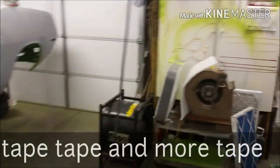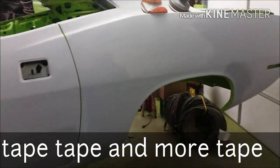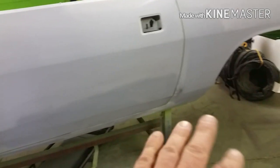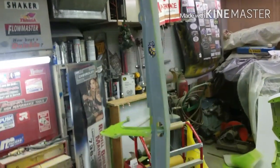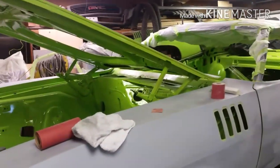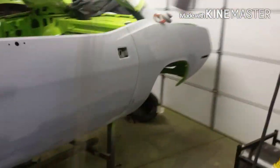Hey YouTubers, we're back out here — still in primer. I left you last week after getting the underside and inside done, but I wasn't happy with a few little things: a couple spots where I broke through the primer, a few nicks here and there, and some body lines to straighten out. I also found a couple cracks on the back side that I needed to fix up first. So today's the day — we get this place cleaned up, get this thing taped off, and tomorrow morning we'll shoot it. If I don't get it done this week I might as well stick it in a sea can and forget about it for 20 years.